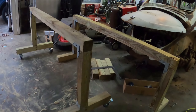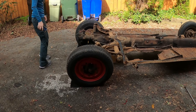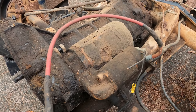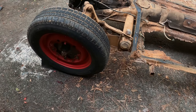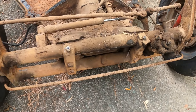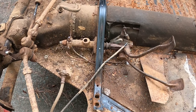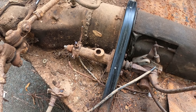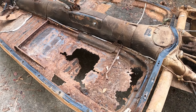A couple days in — this is the before video. I got the chassis out finally. You can see it's got a six-volt starter that's going to have to go. Look at all this grime from 1965. The red wheels will have to go, floor pans will get cut out and replaced. The front beam looks good, everything looks straight. I'll replace the single with a dual master cylinder for safety purposes, and I'll replace the whole emergency brake setup — that's only about 40 bucks.